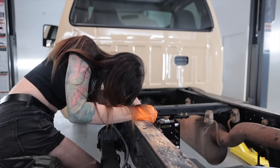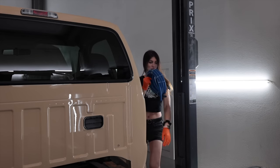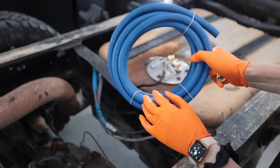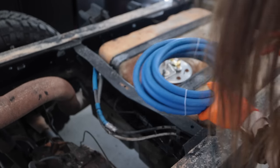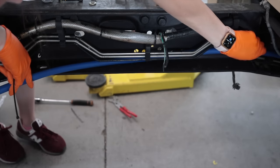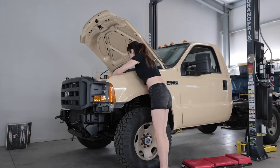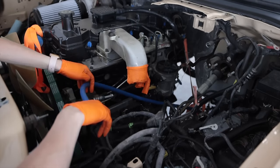While this fuel system does have a return hose on the pump, I still believe I'm going to have to keep the return line coming from the engine to feed back into the tank for any unused fuel up there. It doesn't say to do this, but the truck is gonna be off-roading a lot. I'm actually using some gel-based Loctite — it's more like toothpaste grade, although I wouldn't brush your teeth with this stuff unless you hate your mouth. The most logical way to do this is to replicate what the factory did with the stainless lines — I've got a pretty good path right along the frame rail, like the factory lines, but I want to wrap this thing in chafe protection. I officially only have enough hose to reach the engine.